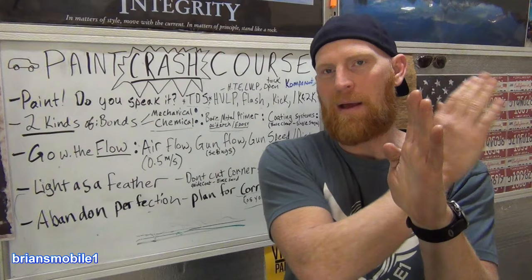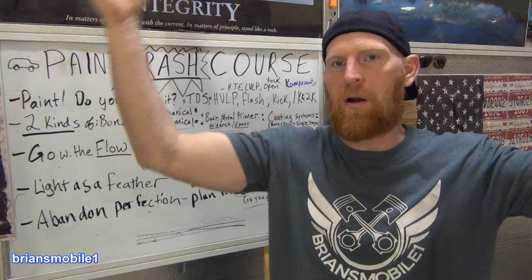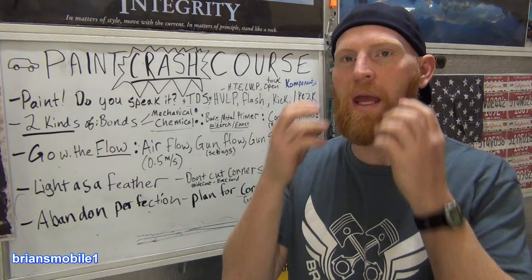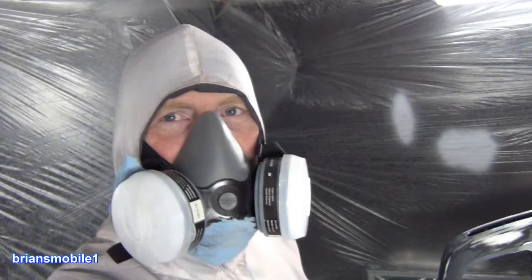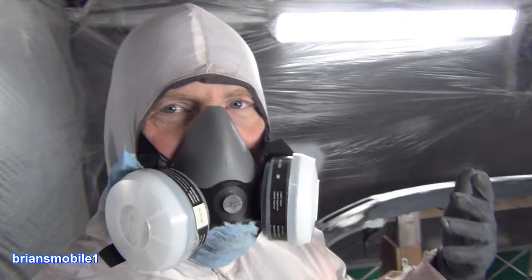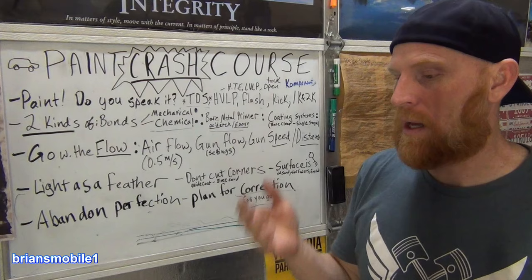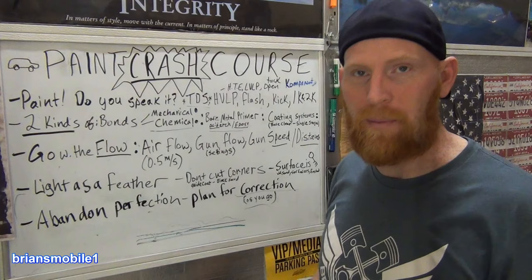This does a lot of things. If you have this fog of stuff, it's hard to get a good glossy clear coat. And clear coat is one of the foggiest, stick-to-everything things. I didn't have good ventilation when I first did the hood, and I got my beard glued up because I had a mask and I had a cover hood, but this much of my beard. My eyelashes were gluing together and it had a rough finish. It was really hazy. It took a lot of sanding and buffing to get it back to gloss. But because I did base clear, I could totally fix that.